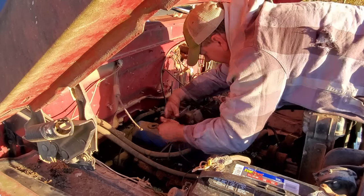Carburetor rebuilt. It was pretty good. The old chem dip did good. I didn't have any stopped up holes, but the accelerator pump area, it ain't looking good. Really corroded. Got a little check ball in it that's captured, you can't get it out. It's pretty corroded, and the little aluminum seat for it is pretty bad. So probably ain't going to have much of a pump shot on that carburetor.